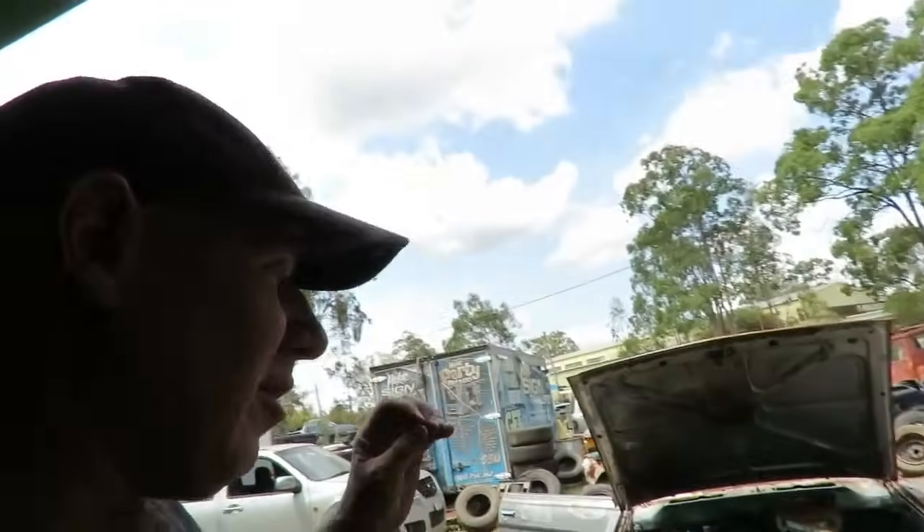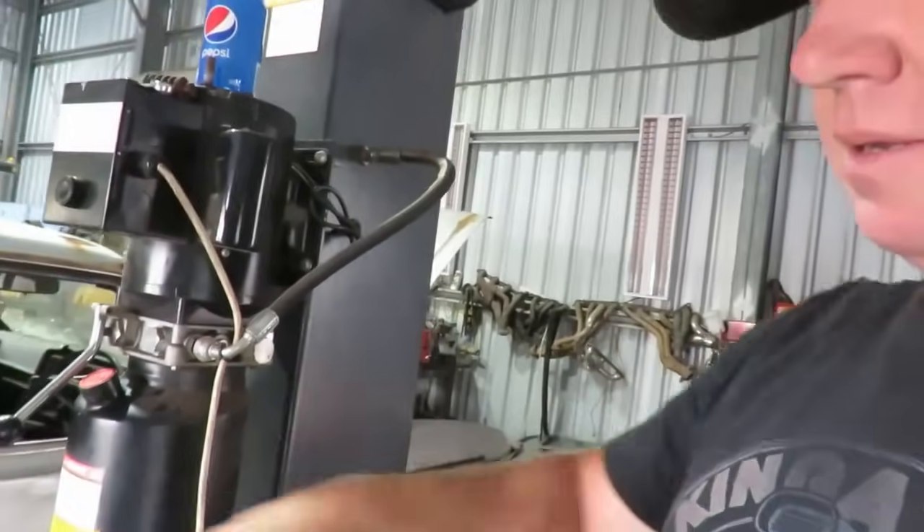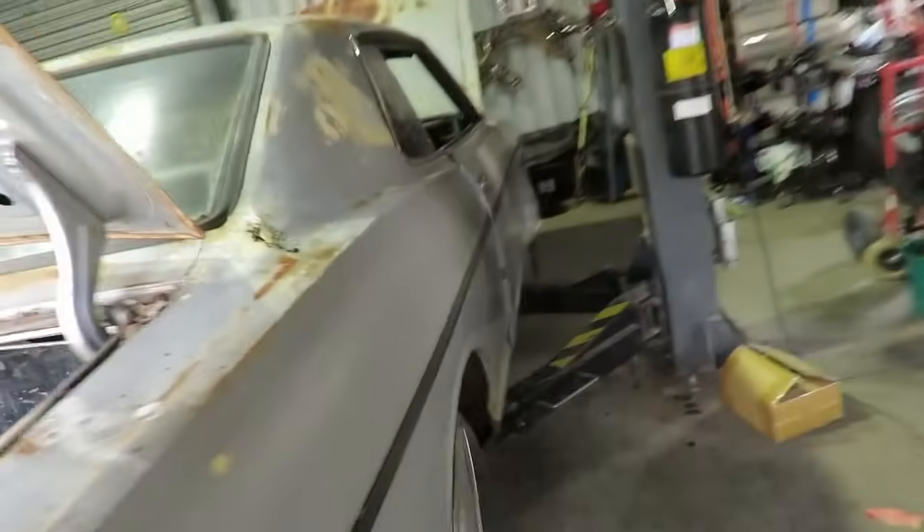Let's get it in on the hoist. It's gonna come up good - I've seen it this morning half clean and the little bits we've done, it's gonna come together good. Look, I'm pumped. So brakes are bled up - the front's bled up a bit, this rear one bled up, and the nipple for the bleeder snapped on that side. So we've got enough to drive it if we have to.